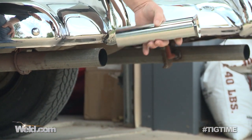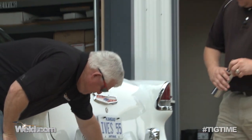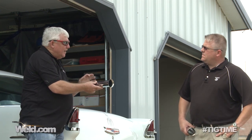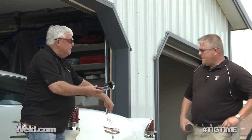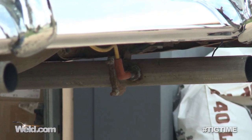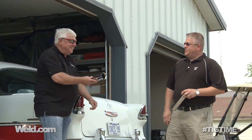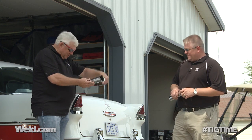It sticks out way too far right now. About how far would you like it to extend? About two to three inches back — just enough to clear the bumper. We're going to crawl in there, mark it, use an abrasive cutoff wheel, cut off what we don't need, put this back into place, clamp it, TIG-tack it, and weld it 360 degrees so it's hermetically sealed. Now you've got a spark plug under there — what does that do? It's a flame-throwing kit. Whenever you're cruising at night, it kills the spark to the engine and puts spark to coils in the back, then shoots flames right out the back — the Batman effect. Pretty much, exactly right.